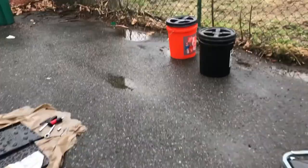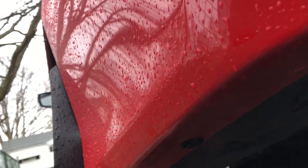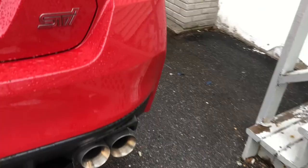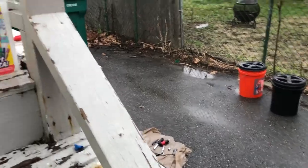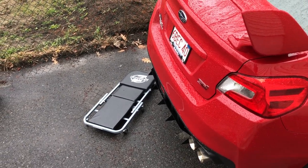It's still raining but this is looking awesome. The next thing is the side panels — get one of the panels and you'll see holes on it. Align it with the bottom holes already in the bumper — no drilling required, the holes are pre-made. Then use the provided push clips and tag them on. Note: if you have the JDM splash guards or spats, you'll need a different piece they provide for that fitment. I haven't tightened anything yet — I'll tighten everything at the end.